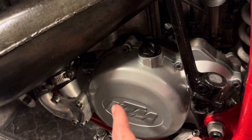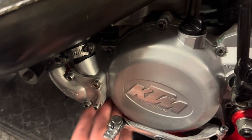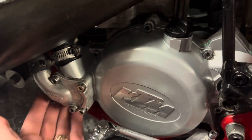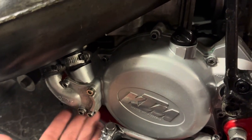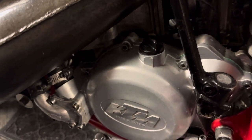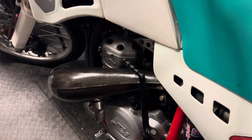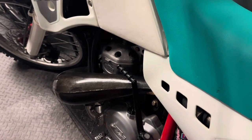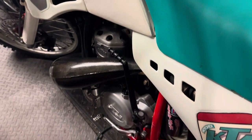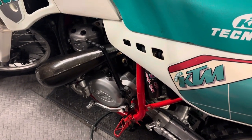pre-94. They used magnesium. So if you're buying one, you want to check underneath for leaks, water, coolant, all this area here. You can have repairs. Look for steel stick repairs or epoxy repairs, anything like that, because it starts to degrade and basically come apart. And then you end up with leaks. Yes, it can be repaired, but it's really tough when they get advanced and can really make a bike that seems like a good deal be very expensive.